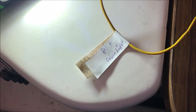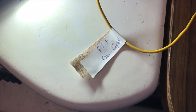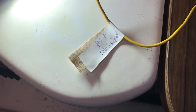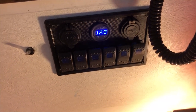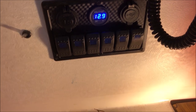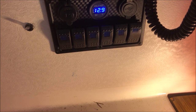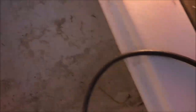Yes, I am laying upside down with my head in the hole, which is why my breathing sounds funny. Now we'll go back in the shop and make up a replacement wire for this yellow one that used to be the cabin light positive. It's marked yellow — how would I know it's positive if I didn't mark it? When we installed this switch panel, we set it up so that all six switches are pre-wired and go down to a bus bar. When I want to power up an item, I'll only need to fish the wire down to the bus bar and tie it in there.